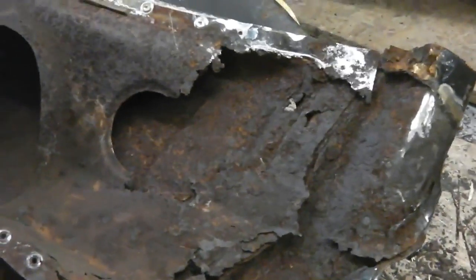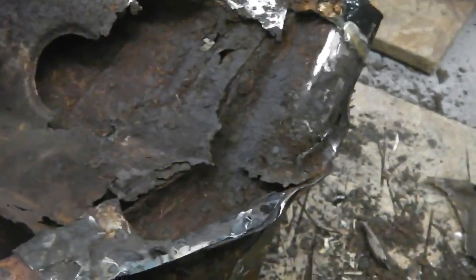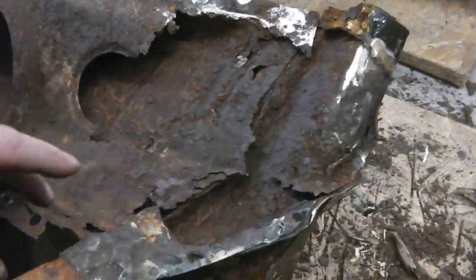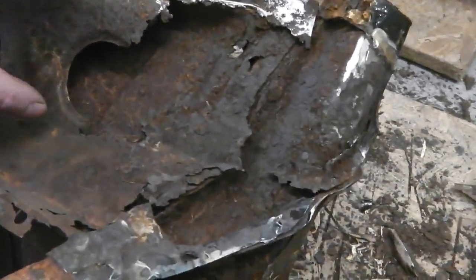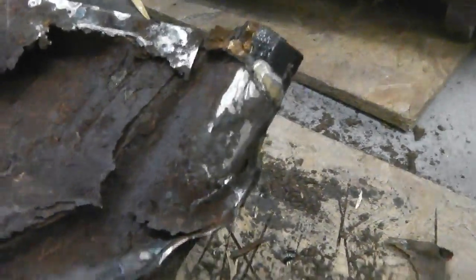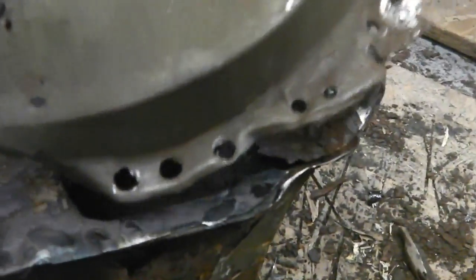Now, to recreate it, we're going to try and recreate this. You can break it down into sections if you don't want to make it, because it's quite a complex pressing. I would suggest three sections of metal here, one strip there, a second and a third strip. Now you can see the extent to which this panel goes. We've been digging for clues. We've had the flap wheel out and we've cleaned it back. So we've cleaned off the remnants of the original scuttle, which sat round there like that. That's off.